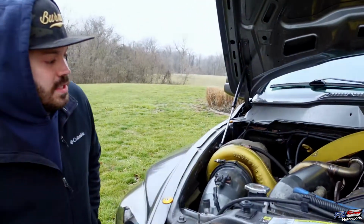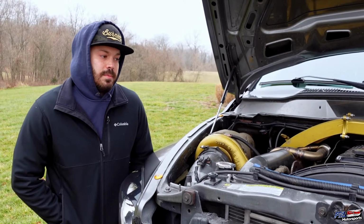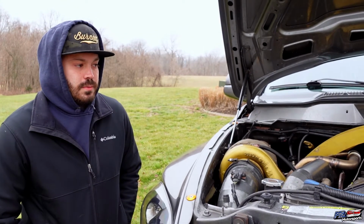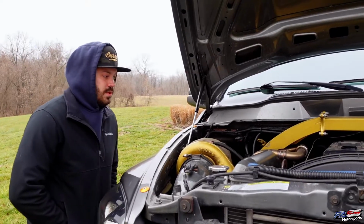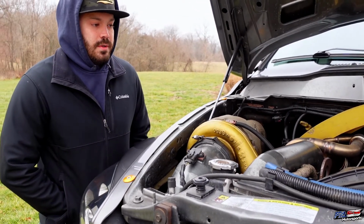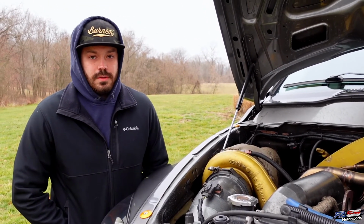But so besides the turbos, Dynomite, they built the injectors. It is also using a 12 millimeter CP3 from Dynomite. It had duals on it, but went to a simpler design and able to fit it a lot better. Transmission's fully built, billet input shaft. There's dampener in the converter. It's had all the valve body work.